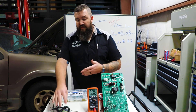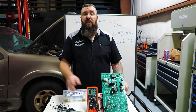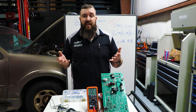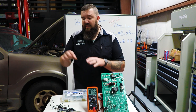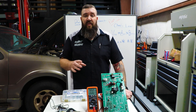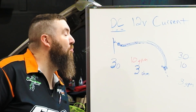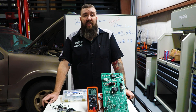Don't always rely on a fancy LED test light or even the ohms reading on your meter — always use the voltage drop test. That's about all the information we're going to be putting into part two of this series. I did want to remind you guys that this is a cooperation with SP Tools USA. For more information on the tools, the test lights, or the circuit board we're using, make sure you go over to SP Tools USA's YouTube channel. They're going to have this video posted but it will include all of those things plus maybe some outtakes.